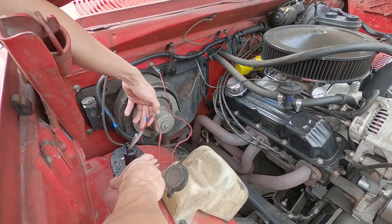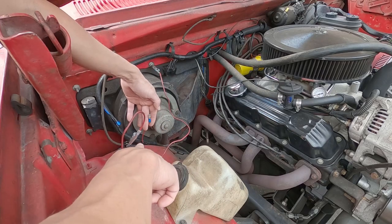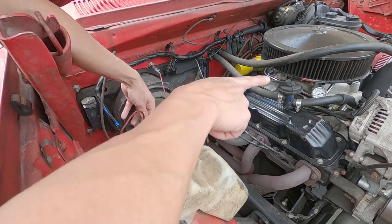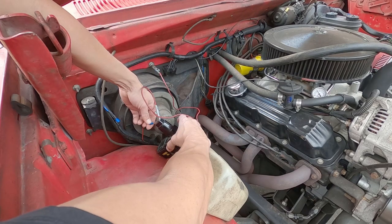Here's the power wire to my fuel pump — this is the key-on power. I have my drill battery hooked to the ground. I'm going to power it up and you should be able to see fuel pressure go as soon as it picks it up. You can hear it now — already got fuel. See, nine pounds. That's because it's got too much voltage.